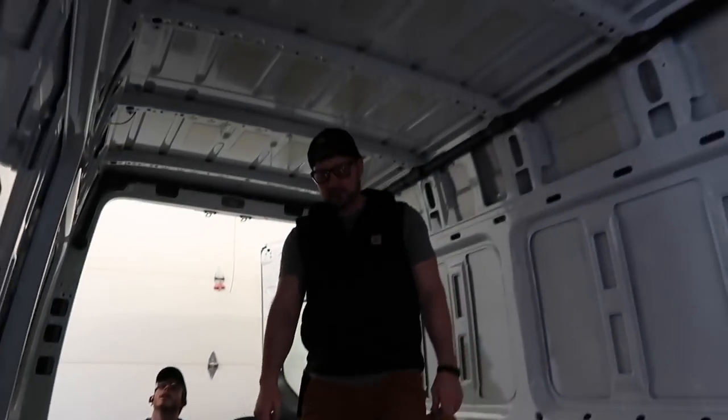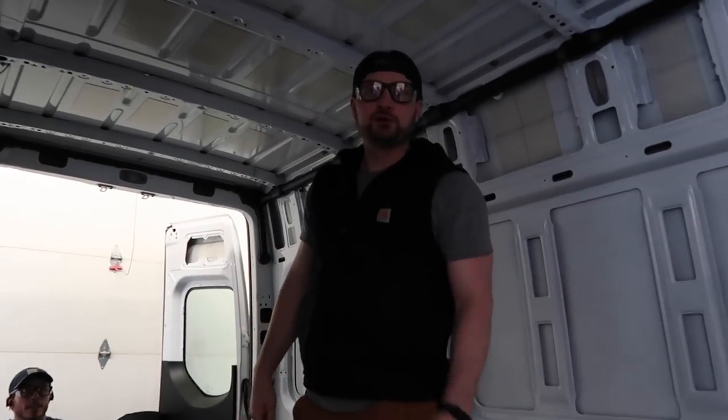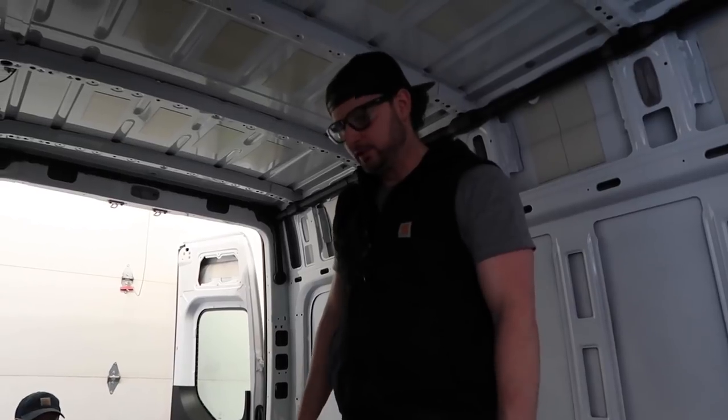Just getting this foam laid. Here's the thing — you're probably going to want to go crazy with insulating your van floor, but it doesn't really matter that much. Insulate it, but don't go nuts, because you have a giant windshield in the front of your van that transfers heat and cold more than anything else you could do here. Plus, if you're putting in vinyl flooring — which I highly recommend — it's plastic, and if it's cold outside, plastic is going to be cold. So what are we doing in this van so that our plastic floor isn't cold?